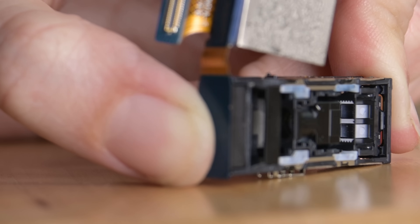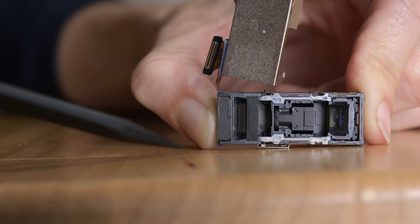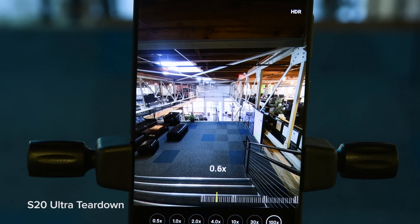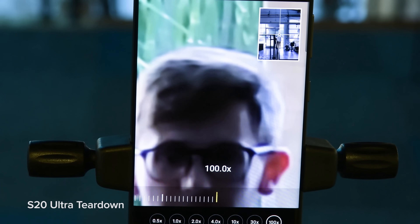Samsung introduced its periscope camera in the S20 Ultra, and it uses a clever combination of software and lens technology to achieve its 100x zoom. Using an optically stabilized prism, light is bent 90 degrees and shot through a series of stacked telephoto lenses. You can see our green laser dot dancing in the image sensor after getting deflected by the teensy prism. All that engineering only gets us to 10x optical zoom. For the rest, Samsung uses a combination of cropping, pixel binning — a fancy way to describe combined groups of pixels that gather more light — and standard digital zoom to get you all the way to 100x.